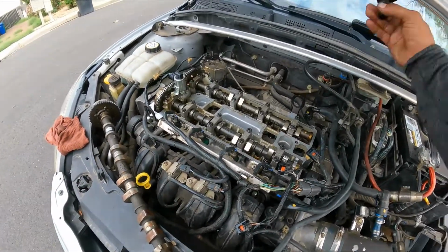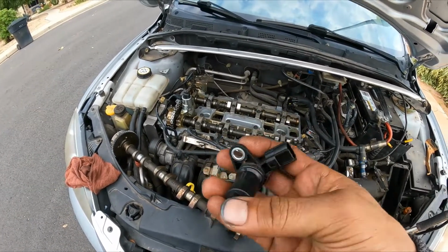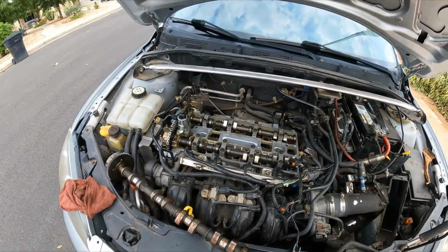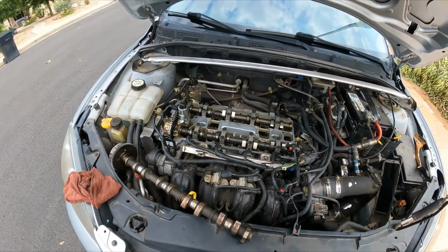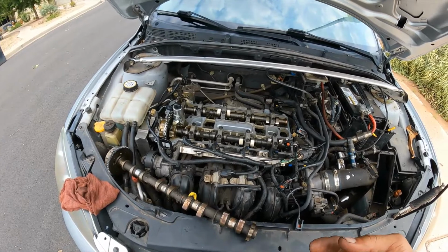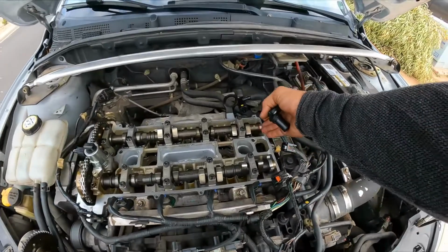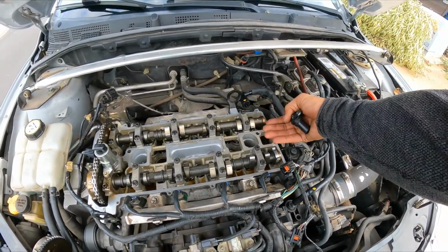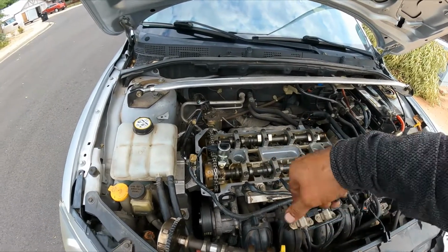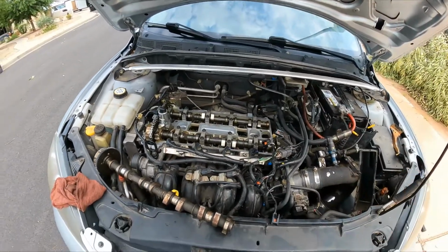Okay, camshaft position sensor. Unfortunately, with this vehicle this is a very common issue. It could be the sensor, the pigtail, the valve cover, or the timing getting off, even when customers neglect services and run low on engine oil. Then you have to realign the timing with the tools. A big metal bar goes on the back of the two camshafts. You have to lock the crankshaft and line up the crank pulley with the timing cover, so that the crankshaft sensor, the camshaft sensor, everything is in time and the car should start.